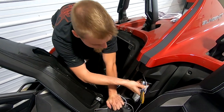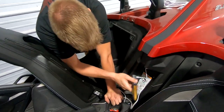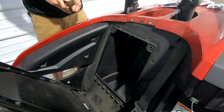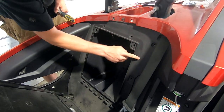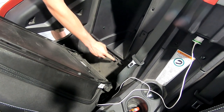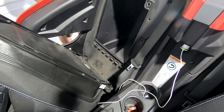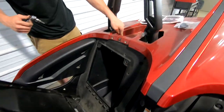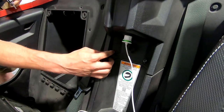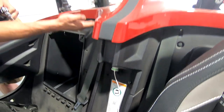All those push pins and stuff. So I took all these push pins out — they go all the way down here. I took the door off right here, just push it up. And then there's a screw up here for the fairing. Then we're taking out this one and this one, pop this out, and then we'll get this fairing off.